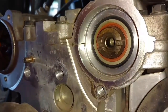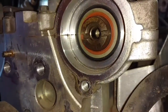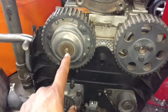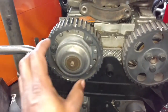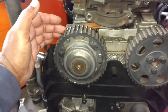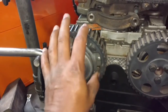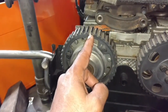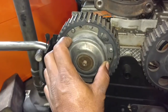Let me show you one that has been put together, and then we'll talk about the front of the VVT hub. Right in behind here you can see the same situation with this VVT hub. The slot's almost straight across. It had that cam locking tool on, it's been removed, and it's got that little notch on the bottom side. Before you put the belt on, this plug is actually out of the hub. You got the bolt that goes down inside there that bolts this VVT hub onto the cam. Slide the cam VVT hub over the cam. Rotate it clockwise until you get your mark to come all the way around and point back at the top. Then take the center bolt and snug it down — don't torque it all the way down, just snug it down.